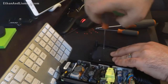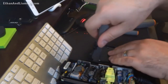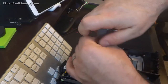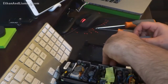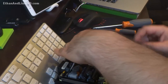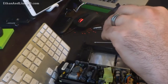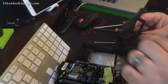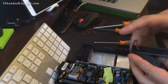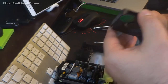I'm going to pull out the smaller screws with a smaller screwdriver. They should come out fairly easily — they're torqued in a little bit but it's just plastic and there's no cement or anything holding them in place. Now that we've got those off, the piece of plastic housing the fan should come off fairly easily. It's not glued in, not clipped in — it's just sitting there. The larger screws were holding the fan to this top piece of plastic, this little shroud. Be careful with this little cable — it comes through this little shroud. I'm going to show you how to disconnect that cable.